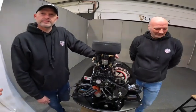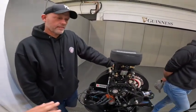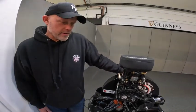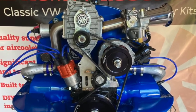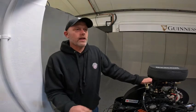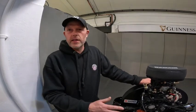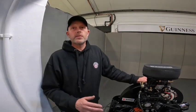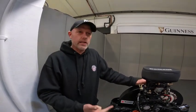And Dave Godfrey. Mark, tell me a little about this setup — you have three different phases? That's right, we have three different setups. We have a sleeper kit which runs on a Harley Davidson motorcycle carburetor — an SS Shorty. It's a sleeper kit because it fits under the deck lid. It works on a standard 1600 engine and it'll give you about 90 horsepower — nice tick-over, smooth acceleration. It's kind of the starter kit.